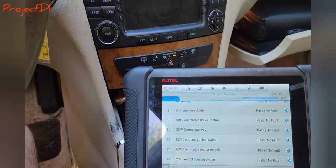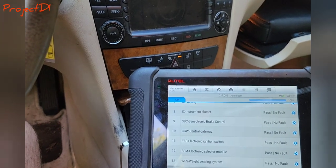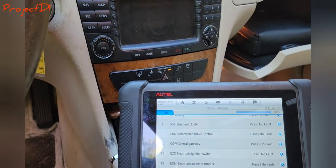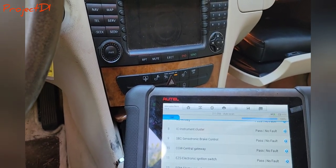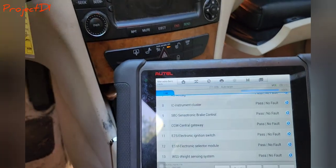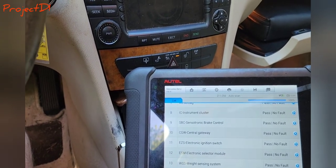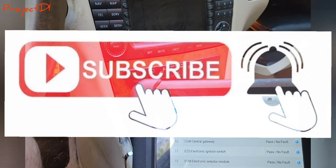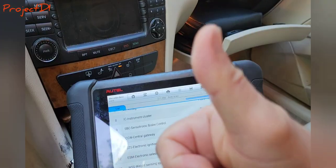Remember, this car is a project at this point — we're trying to fix as much as we can, it's a work in progress. But this is the procedure you can do to fix your EIS by yourself. It doesn't require you to be an extremely skilled person — yes, you need some skills, but you should be able to solder it and fix it. Hopefully this works for you. It works for me most of the time — I've had one or two failures, but about 80% of the time this has worked. Thanks for watching, please like and subscribe.